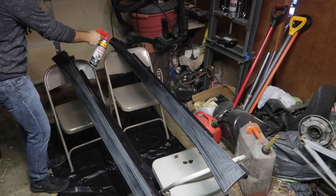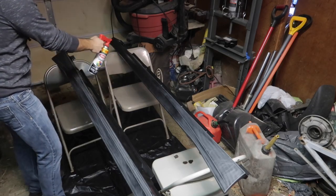Not only did I make the mistake of sanding a brand new plastic piece, but then after that, I went and sprayed it with a 2-in-1 primer and paint six times. And that left me with this result. The whole thing looked like crap. I didn't clean it. I didn't rinse it. I didn't spray it with adhesion promoter. I didn't use a special primer and a special paint. I did everything wrong.